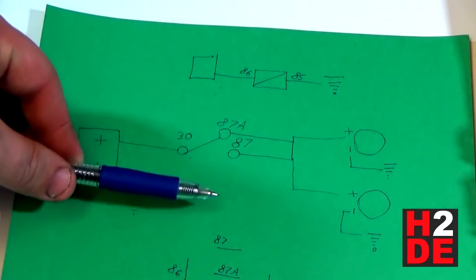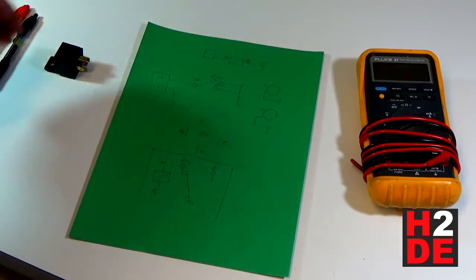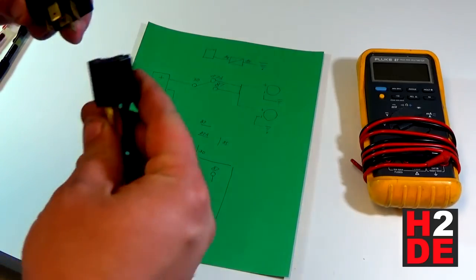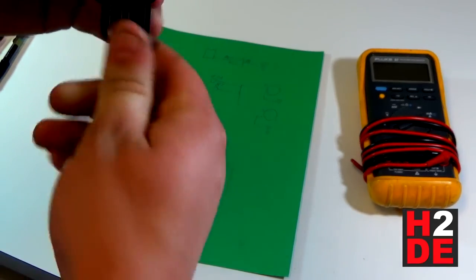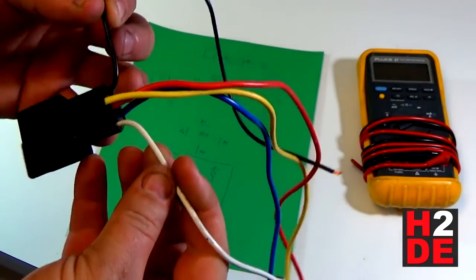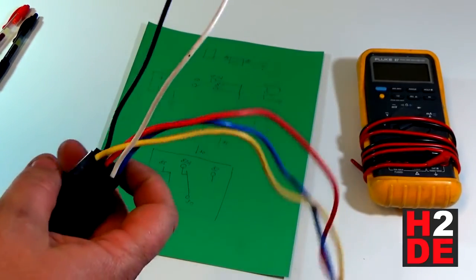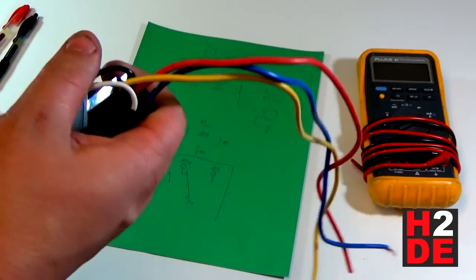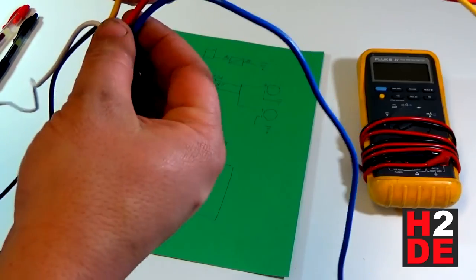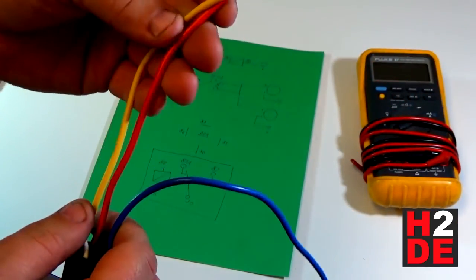So that's the difference between normally open and normally closed relay circuitry. I hope that helped you understand how these 12-volt automotive relays work. You can get the pigtails where they plug up and you already have the wiring. The two outside wires are thinner gauge because they only control the coil, which doesn't take much current. The three inner wires are a much larger gauge — these are 12-gauge wires — to support 20 amps on this automotive circuit.